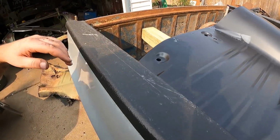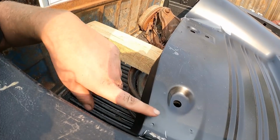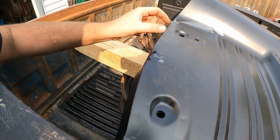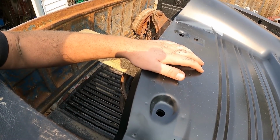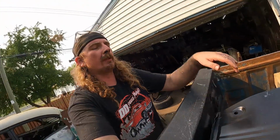And at the front here, you can weld these. I'll probably put some holes in it, but I also like to just grind right across, and I'll stitch it all together. Seems like there's a bit of a gap at the front of these floor pans. I've done lots of Tri-Fives. I don't know what everything else is like. The Dodge I did was pretty good, but A-bodies and all those things, like Chevy stuff, I have never done.